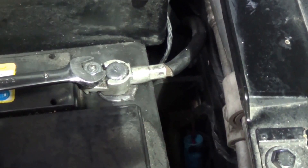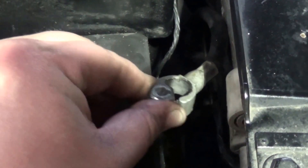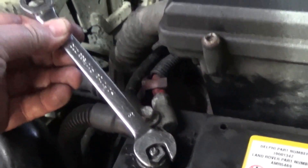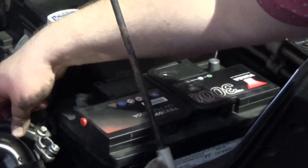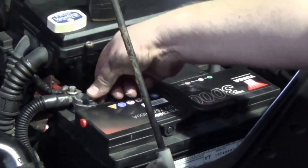I'm back with a new battery. I'm just going to take the old one out. It's worth mentioning that when you take the battery out, you should always disconnect the negative terminal first and push the cable well out of the way. The reason is that if you were to disconnect the positive first and the back of your spanner caught onto the bodywork or the engine, you could earth through the body back to the battery and have a big flash, explosion, or burn. So always take the negative lead off first. When you put the battery back, put the positive lead on first and then the negative lead secondly, to minimise the risk of any short circuit.